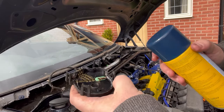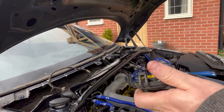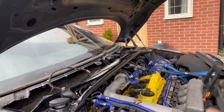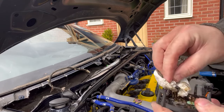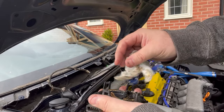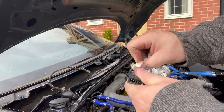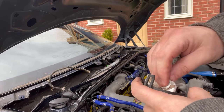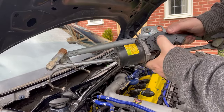Hopefully you can see here — we've tidied the points up, we've bent that little connector up a little bit. You can see it's got like a bit of an arc burn in it — it's had a poor connection. We're going to give this a clean out with some electrical contact cleaner so it's like new. I recommend you do this anyway — don't wait for yours to break because they all break eventually. We've just bent them up a little bit so they make a better contact and given it all a clean out. Once that works, I'll run a bead of instant gasket seal around the cap before I refit it to the motor.